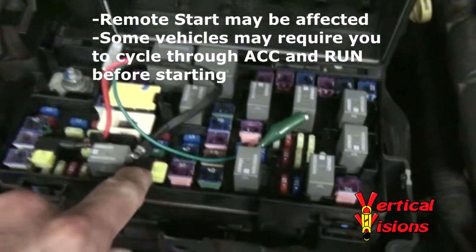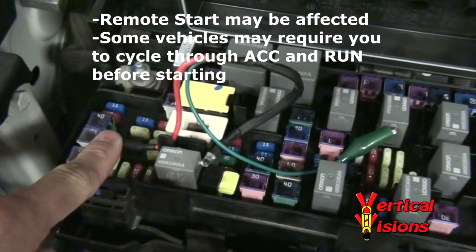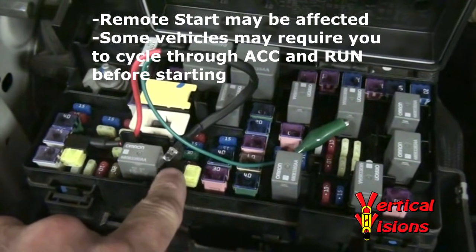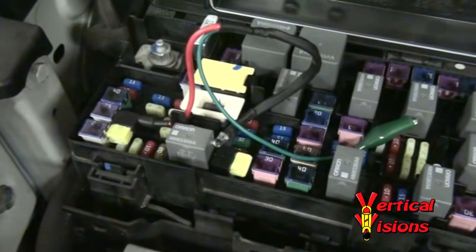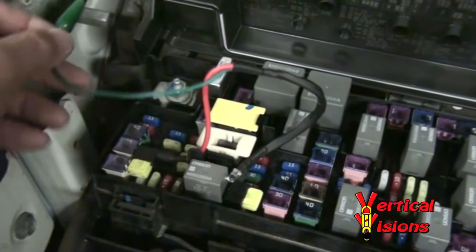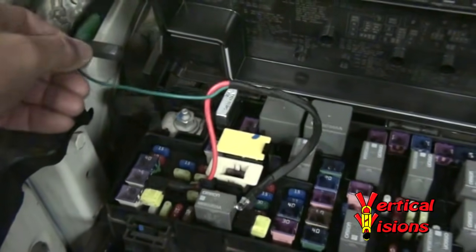Whenever we start it up, power is actually going to be coming from this circuit — M7 rear cigarette lighter — across the cable and down into the fuel pump assembly. Go ahead and start up the vehicle. See, it's running fine. You'll notice I don't need the LED feedback, but if I wanted to, I could simply touch it and I'm still getting power — all is well.